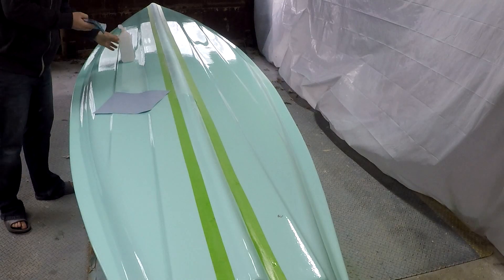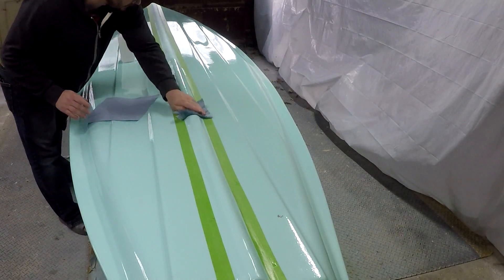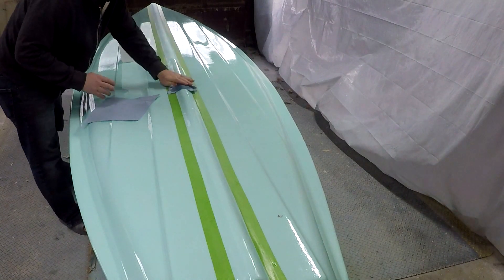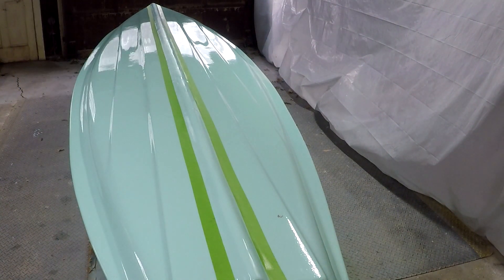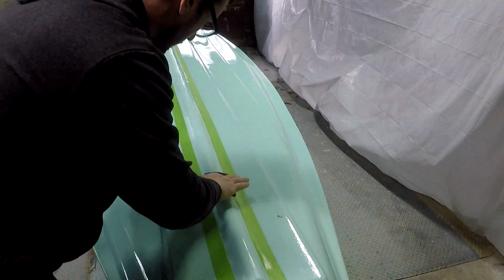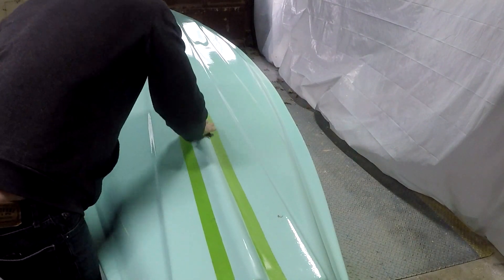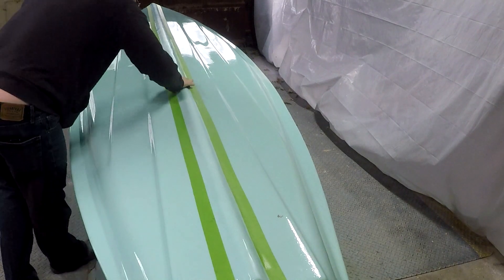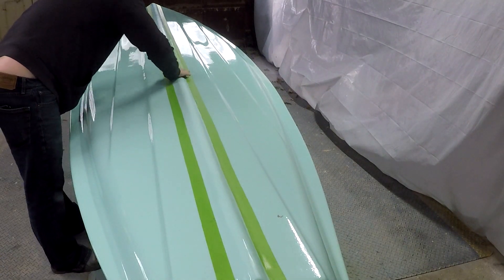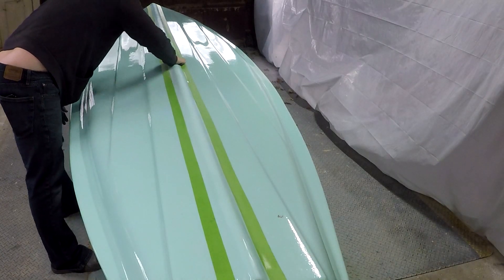Probably use a new shop towel or at least flip it over every couple of feet — that will remove any dust and contaminants, and get rid of any leftover wax or polishing compound. Since mine had such a thick coat of polishing compound and wax, I went ahead and etched it twice, because I wanted superior adhesion and many little grooves and scratches in there so the adhesive material could bond effectively.